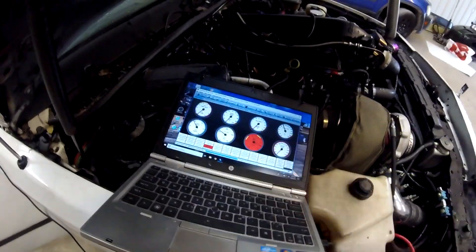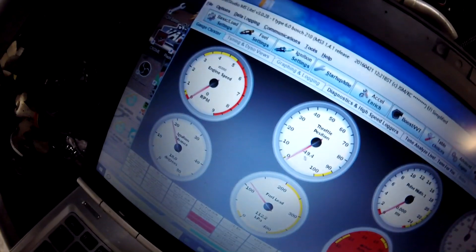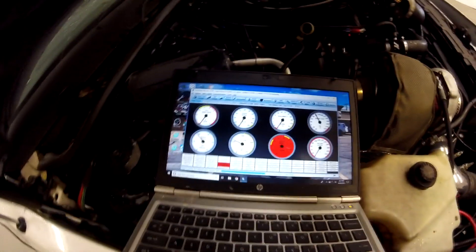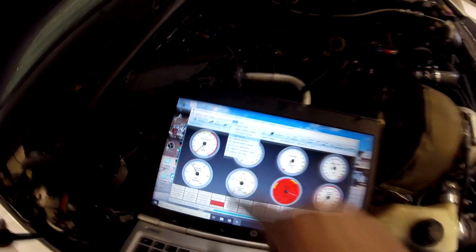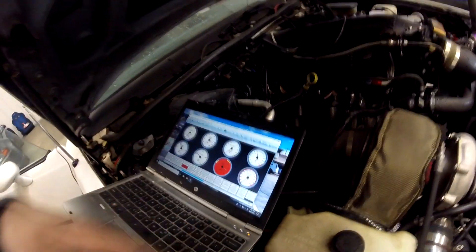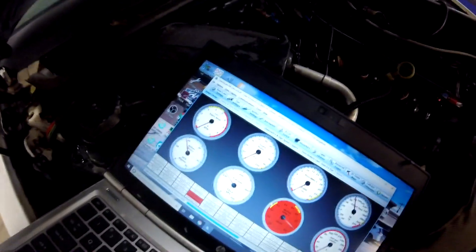Right now you can see we're at negative 51.4% throttle. As we give it throttle: negative 47, negative 50, negative 30, and 0 — about a third to half throttle. Full throttle only goes to 84%. So we'll go to Tools in Tuner Studio, then Calibrate TPS. With the throttle all the way closed, hit 'get current.' Then go to full throttle, hold it all the way open, and hit 'get current' for full throttle. Bring it back down and hit Accept. Now we're at 0.2% instead of negative 50, so it's way closer to zero. When we give it just a little bit of throttle, it does exactly what we need. TPS is set.